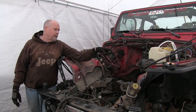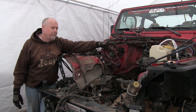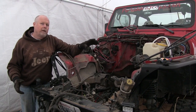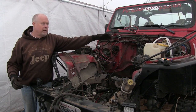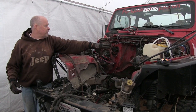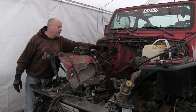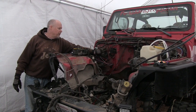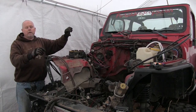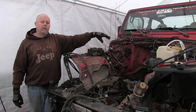The LS — all the wiring comes out on the driver's fender well. After I get this in, I'm going to refit the wire bundle. What I'm going to do is lay it all in here and try to move all the ECM over to this side, back where the factory one was, and rework the whole thing. When I get that done, I'll put the wire looms and tape it up.